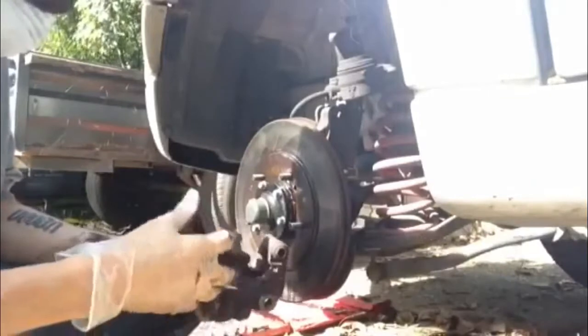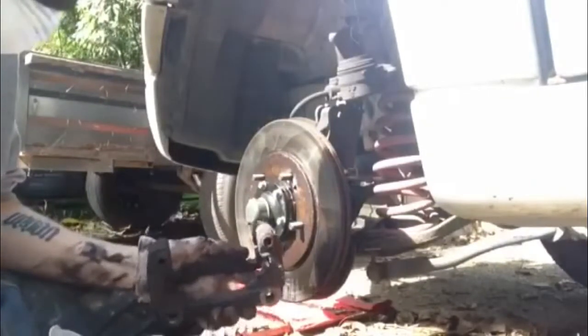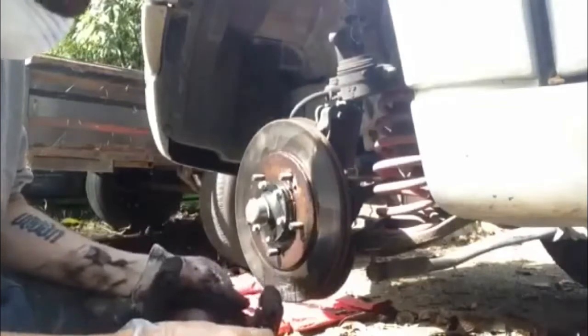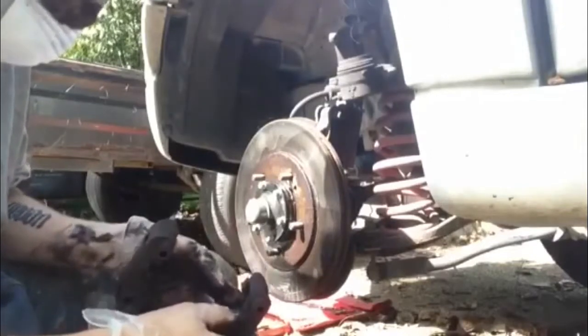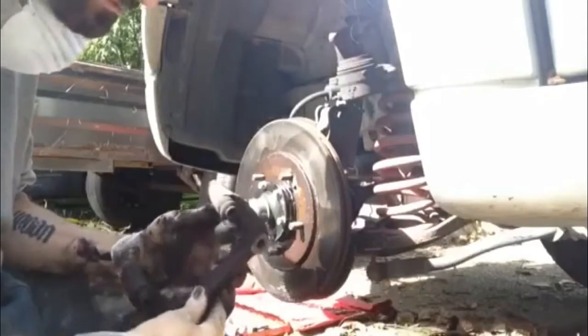When you're doing all this, you want to make sure you're wearing a dust mask, because especially if you're using asbestos pads, all of this dust might have asbestos dust in it — never mind the fact that it's just really dusty. The previous pads I had on here weren't asbestos-based, so I don't have to worry about that part, but there's still a lot of dust involved.